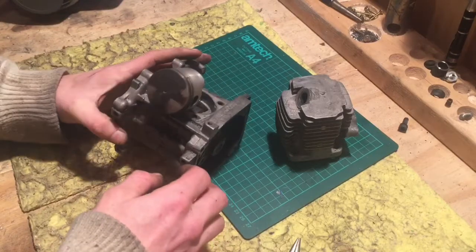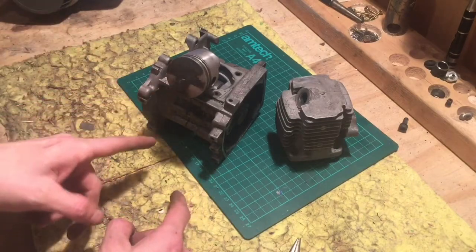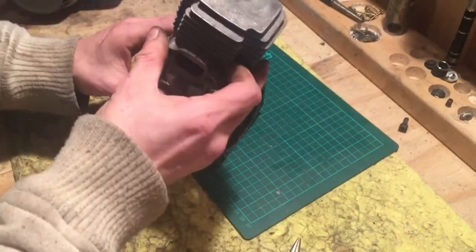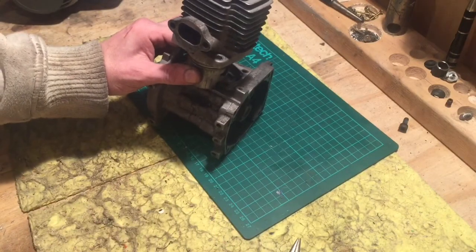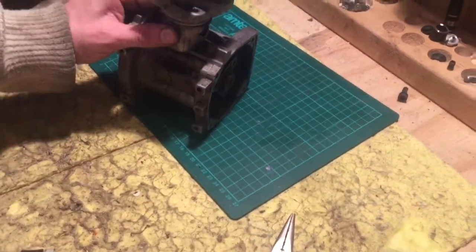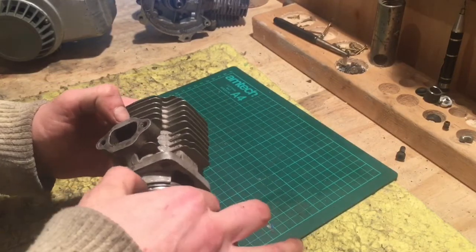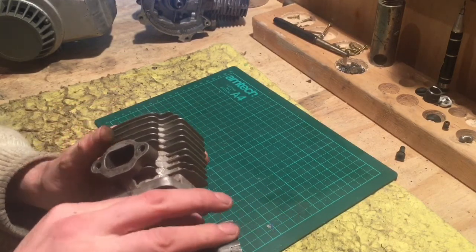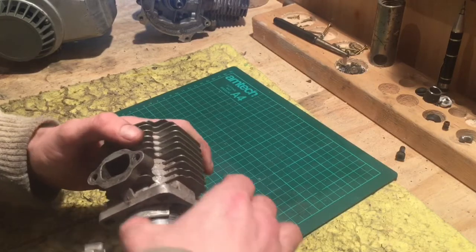So we've got that. We know this is the bottom of the engine and our arrow on our exhaust is facing the bottom of the engine. Now when we pick our head back up we've got to get the exhaust port at the same side. To start with you just slip it onto the head of the piston. Bring it down on the head of the piston and what we're going to do is just squeeze with the fingers, one ring at a time, the whole way round. Then go down onto the second ring and follow it down underneath as well.